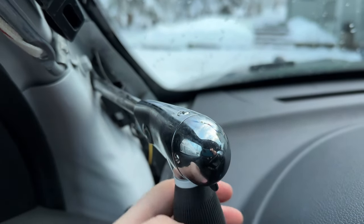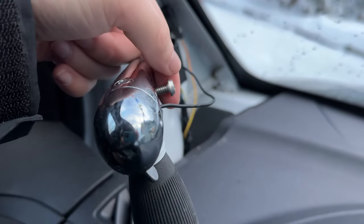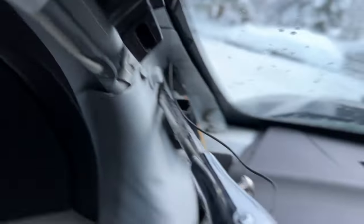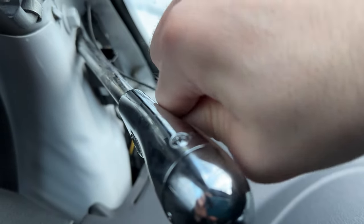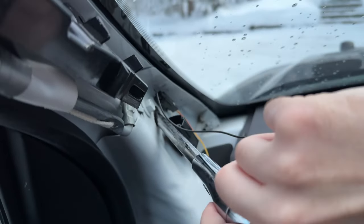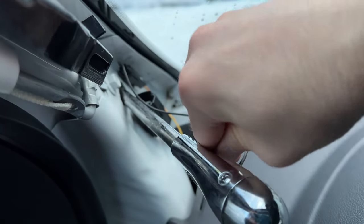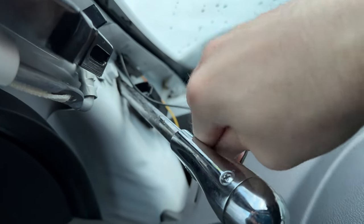You can see there is a nut here and a torx screw — sometimes it's a hex head — that I've already removed. You're going to want to remove this. The way these are wired is that there's only one power wire and the negative is through the frame. So remove this screw on the side.